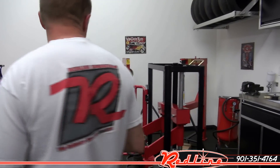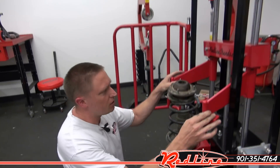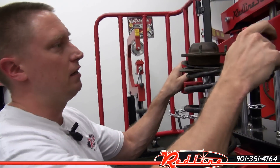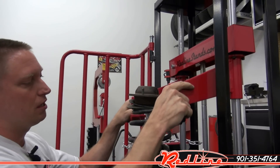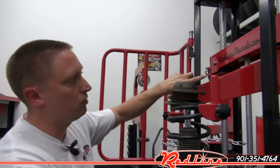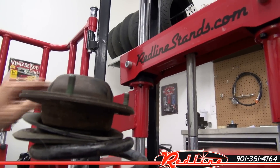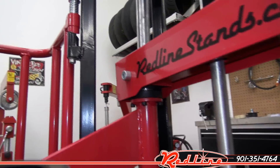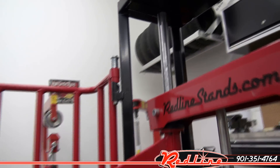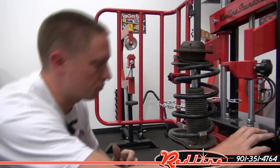If I come around the front side of the spring compressor, I want to talk about a couple of the neat features of this unit. One of the first is that this unit adjusts itself to the spring — it pivots here with arms that will automatically adjust to the spring. Also, if we look up underneath it, we've got nice locks up inside here. As it compresses, those teeth engage and keep that arm from kicking out. Very, very important safety feature right there.